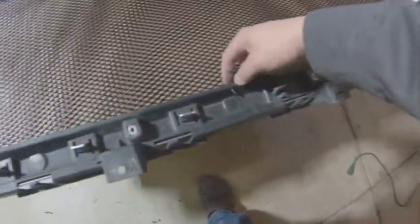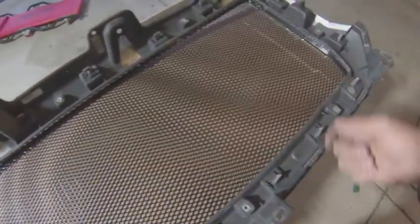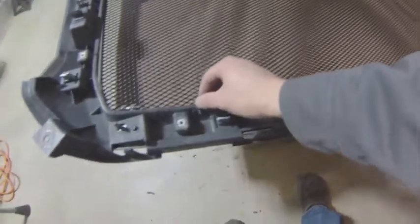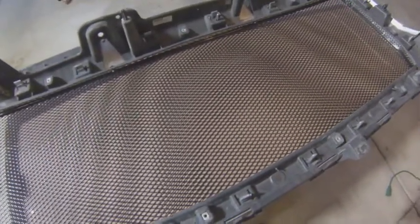Once you get the top ones mounted, temporarily throw the screws in, then you can pull the grill back, mark it with a marker, drill your hole, and go. They say use a quarter-inch drill bit, but I think that hole's a little too big — you can get away with something slightly smaller. As long as your marks are pretty spot on, you shouldn't have an issue. The quarter inch probably just gives you some room for play. I'm pretty happy with how it turned out.